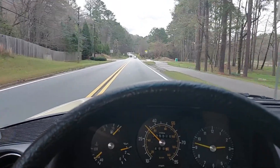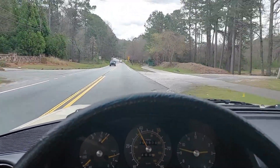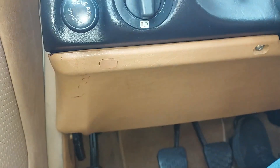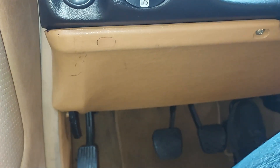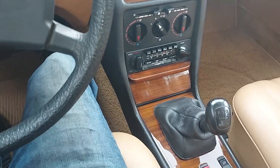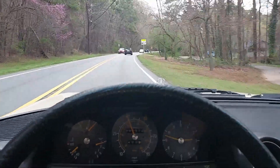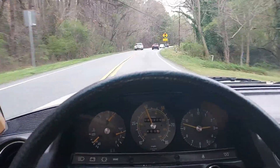We're in fourth just cruising — let's see if this cruise control works. The cruise control does not work, so I'm going to have to get a replacement cruise control module. It's very easy — it's right behind that plastic kick panel. On this car it's bolted connected to the kick panel, so you just fold down the kick panel, pop it out, and put another one in. As far as the driving and the AC and everything else, the cruise control is the last item.